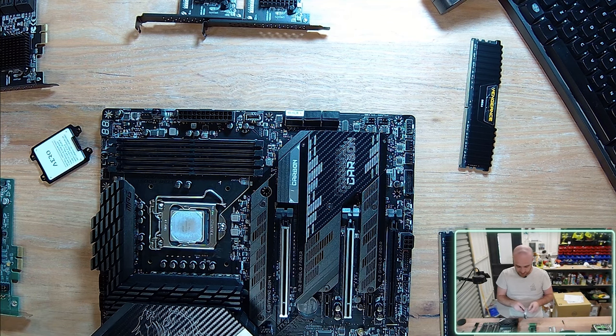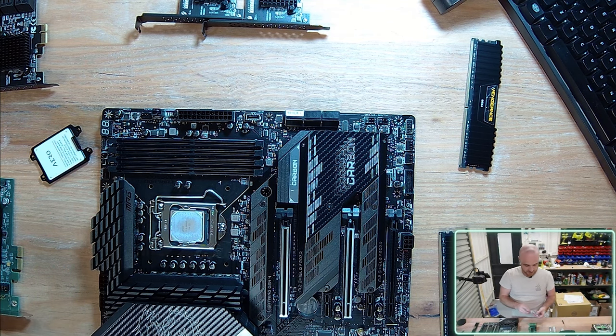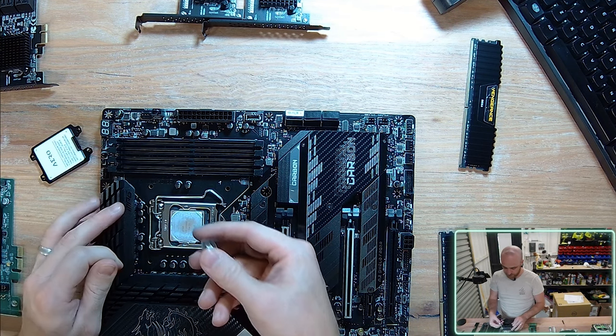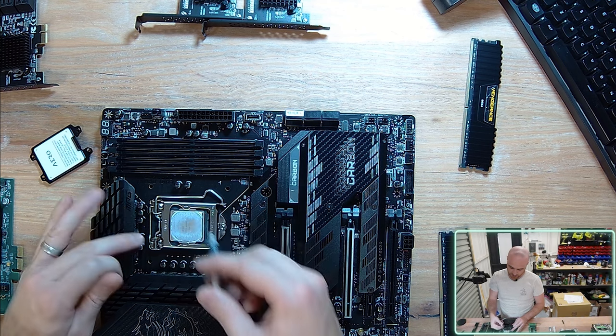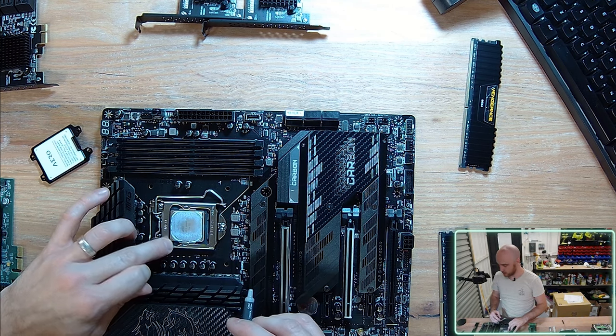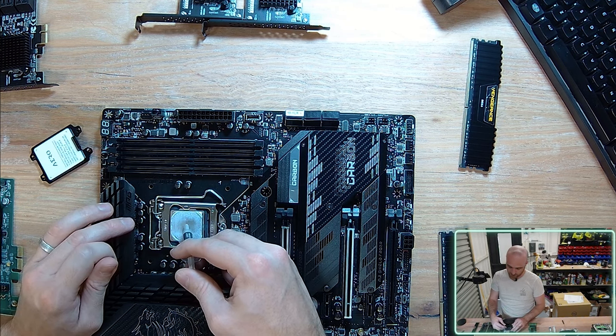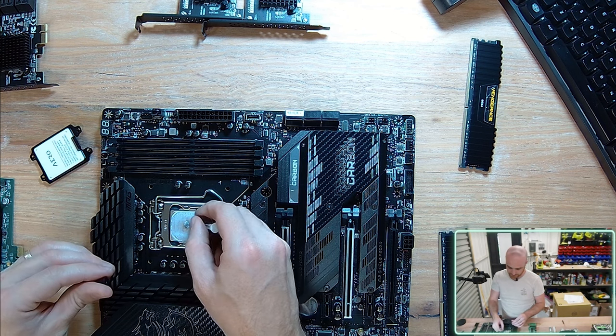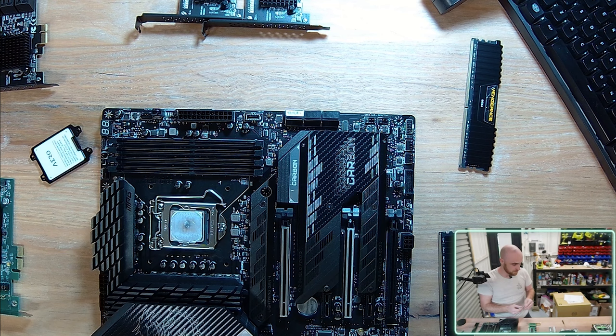Which is very interesting. Those machines, well, this is the Dell XPS 8940s. They don't have proper coverage based on the heat spreader that was installed. You can see there's little bits of metal all around the side that show that the CPU didn't have full contact with the heat spreader, with the CPU fan that was placed on top. Just placing a little dab, probably a little bit too much, but we should be okay.